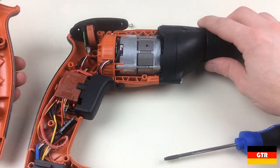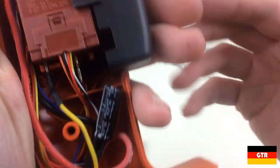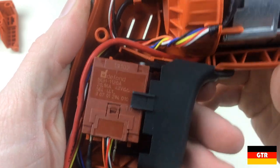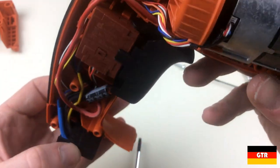Now on to the driver. After taking out a couple hundred self-tapping screws we are finally in. One thing that is interesting is that the heavy gauge wires are going straight from the battery to the brushless DC motor, and only a couple of control wires are going from the motor to the switch. This means that there is some control circuitry built directly into the motor sub-assembly. I didn't see any identifying markings on the motor that would indicate if it was made by someone other than Fein.